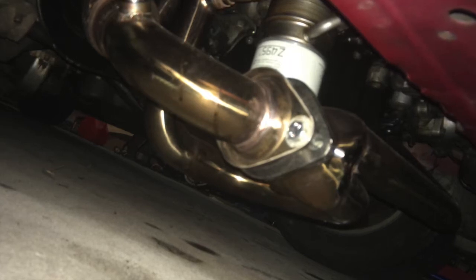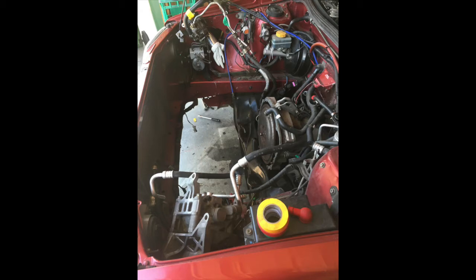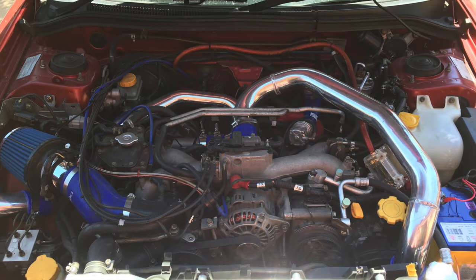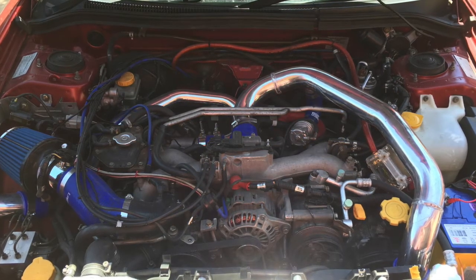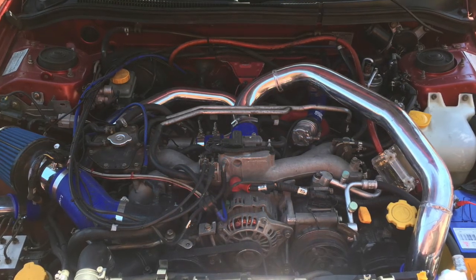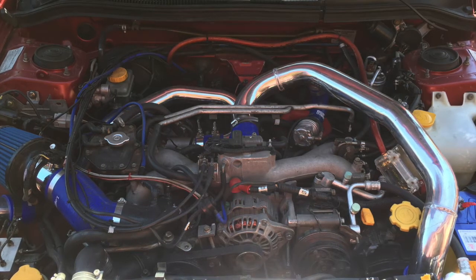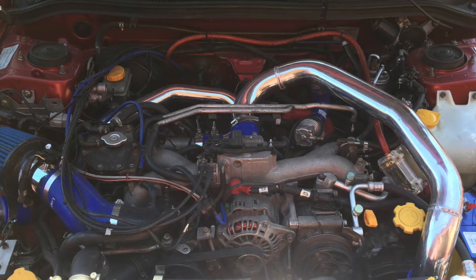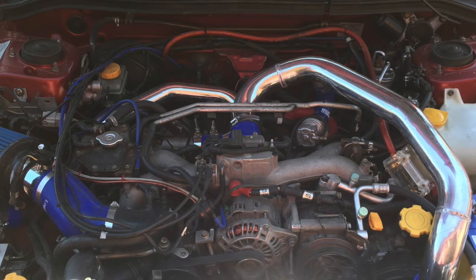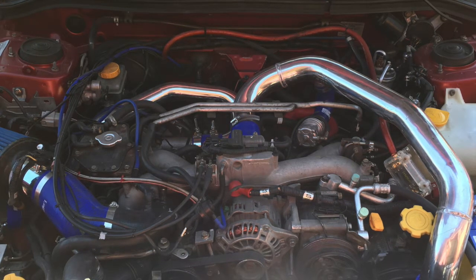Right next to the front subframe — you can see a little cutout just below the rail; that's where the exhaust will go to the low-mount turbo. So the engine went back in, still with the front-mount TD04. It started making a funny screamy noise. The engine came out again and it was the tensioner — the bearings had gone, ball bearings in the cam cover. Very lucky there. So now it came out again and this is where it started.